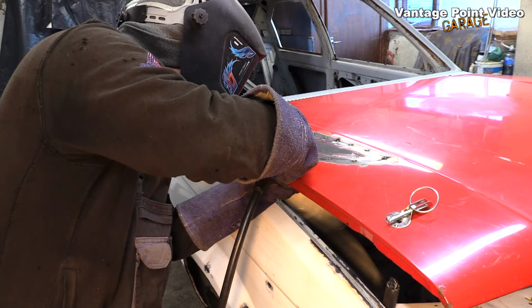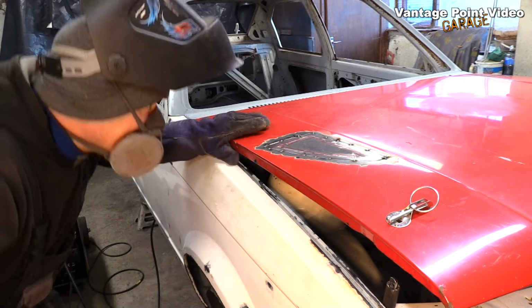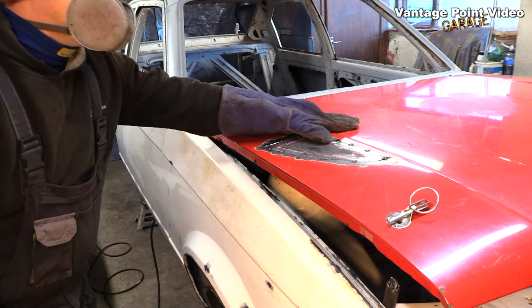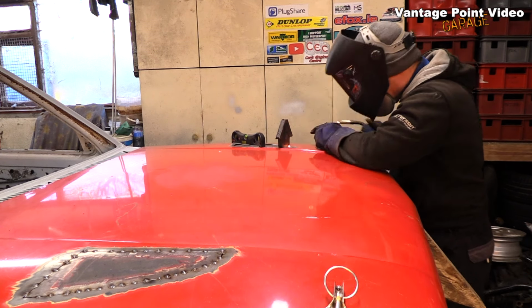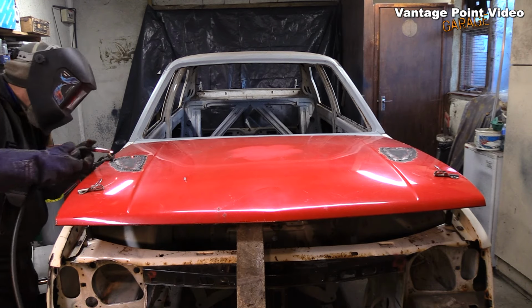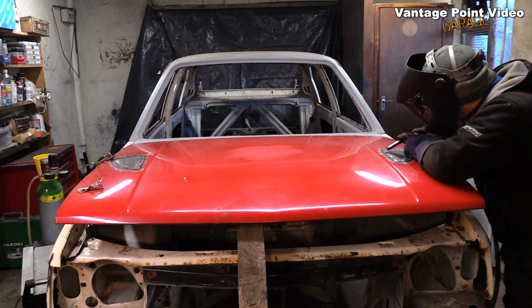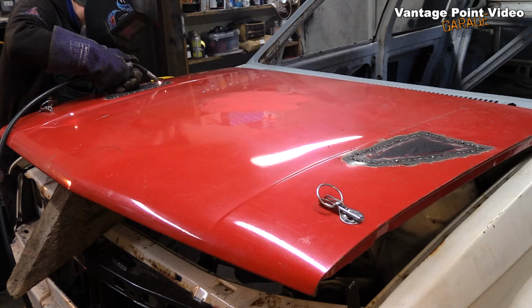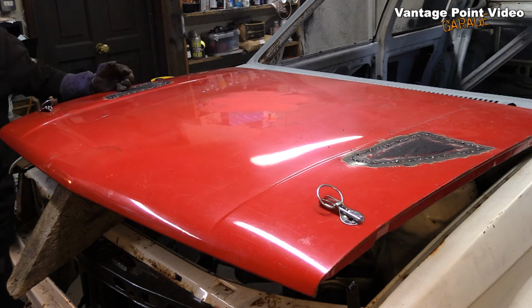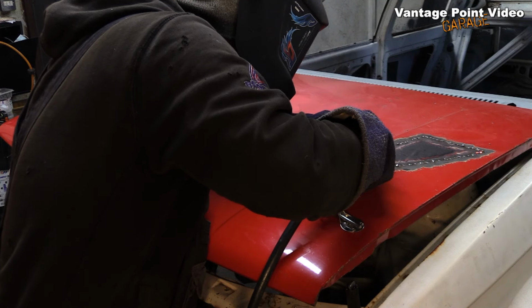I was debating with myself whether to only do a few spot welds and then just filler all along, but I kind of got drawn into it and ended up just putting lots and lots of little tacks in it. I got the other side going so I could switch from one side to the other, allowing for cooling, so I didn't work on either one for a very long period, again to just prevent distortion. And working a couple of spots on one side of the piece and then back over the other side and then over to the other side of the bonnet altogether. Coming together anyway.